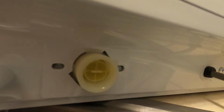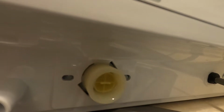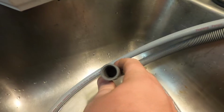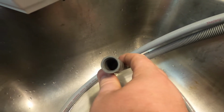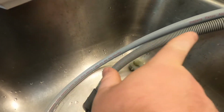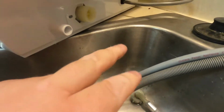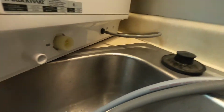It was not plugged up. It looked just the same color as it looks on the outside. There's no other colors, no other debris around that filter inside there. So I went ahead and put that filter back in there. And then I actually checked the outlet hose here for being able to pour away the waste water. And there's no issues, there's no debris in this line. So I've got both inlet and outlet good to go. I've got no blockages inside here.